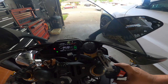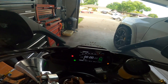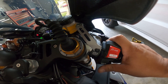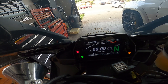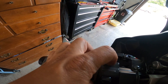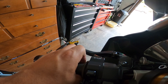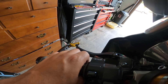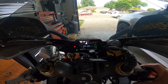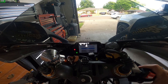To actually use it, click once — that will start flashing. Scroll up once, that will start flashing. Now hold it down and press it. The little dots will start flashing — once those dots start flashing you are good to go into the track. You will use your high beam flasher where it says High Beams and Lap. This is how you actually keep track of laps: every time you cross the finish line you tap it in, do a full lap, come back to the finish line, and hit it again. It's manual, but that's how you do it, and your lap times get stored into the unit itself.